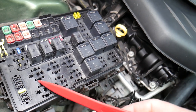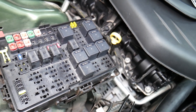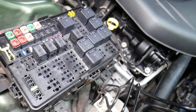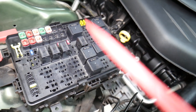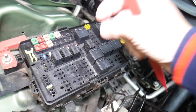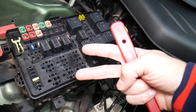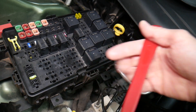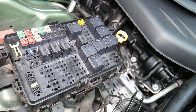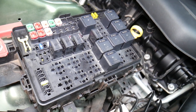For some certain fuses it's important to disconnect the car battery when removing them, otherwise you can burn the electronics. When working on airbags or anything like that, you need to wait at least one hour after disconnecting the car battery. If you're not qualified and certified to work on the airbag system, I'll never recommend you do that. Also, a common mistake people make — it's important to know which battery terminal you disconnect and reconnect first. If you do it the wrong way, you can burn electronics modules. We burned a traction control module on a BMW that cost $2,000. We'll put a link in the description below on which battery terminal to disconnect first.